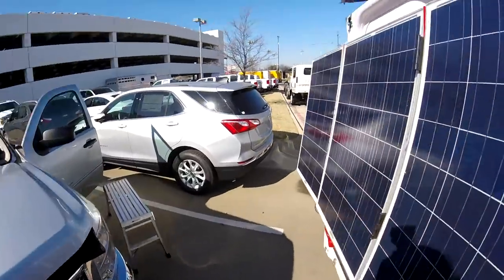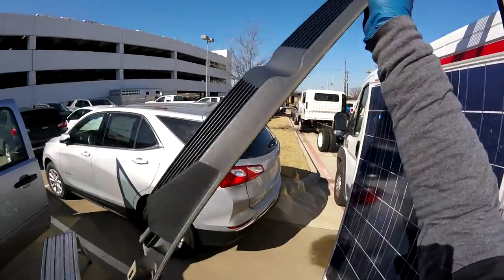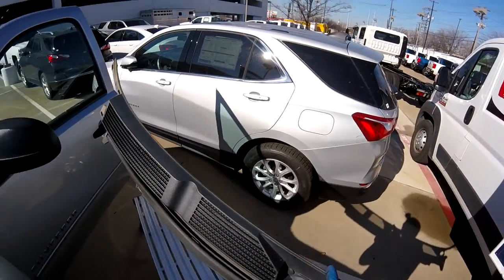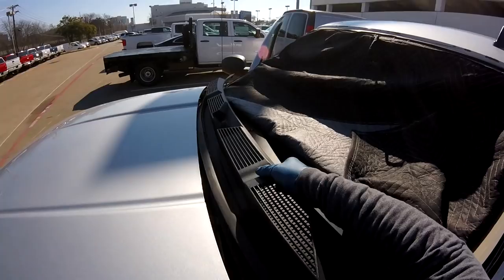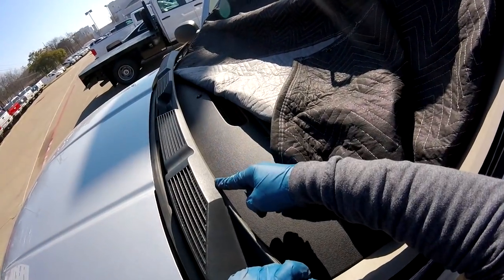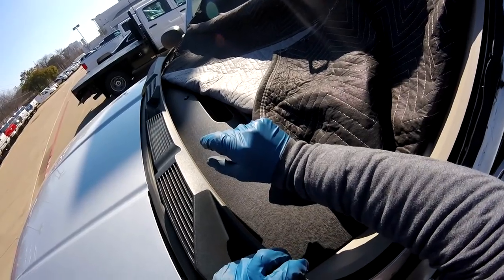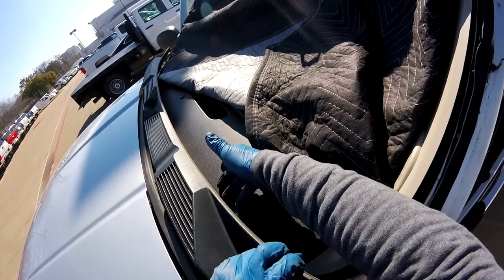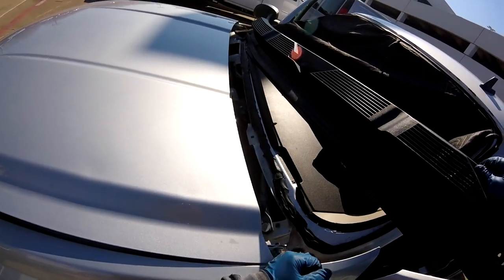Oh, my cowl is over here. When these kind of guys don't want to work too much, what they do is take this one off and don't put it back on, okay? So when the molding is on here and they take this one away and hide it in a truck or just throw it in the trash, they have a gap this big. So that's why when they put the urethane inside, they can slide it inside. But even when they do that, you can see the results right here, very bad.